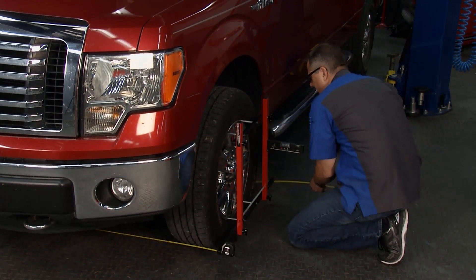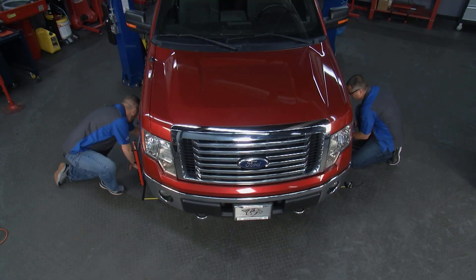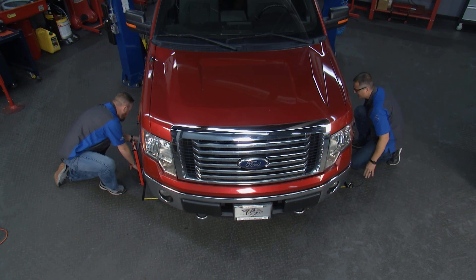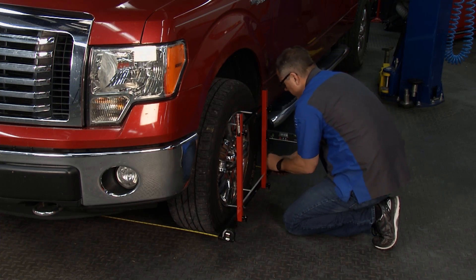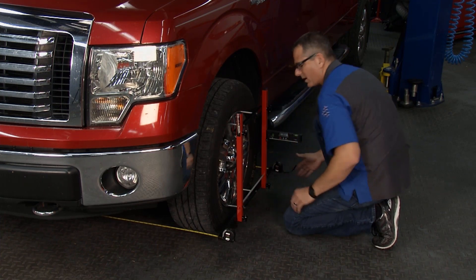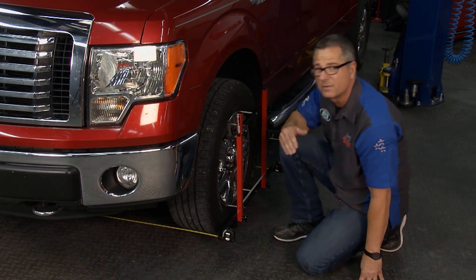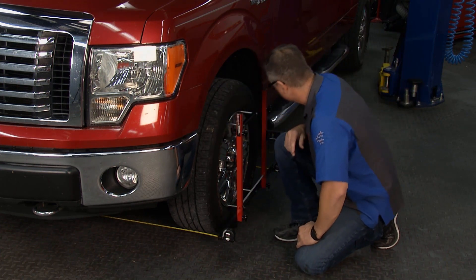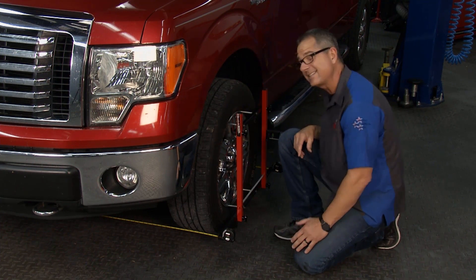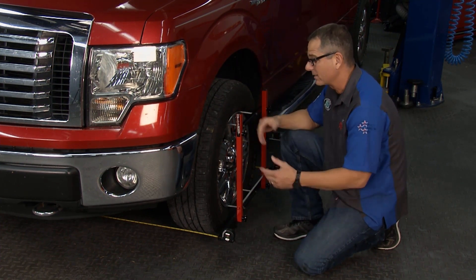I'm pulling a tape from the back tire to the front. We're going to take the difference from the back and front of the tire and it should be about equal. I'll bring it back and lock the tape — everything sits there. It's a one-man operation. You can do that side and come over here, no problem. I'm looking at this one — it's a little over 82, and this one's a hair over 82. So they got the toe absolutely right. If it wasn't, we'd go in there and adjust it.